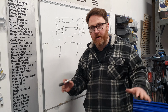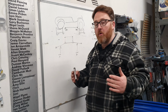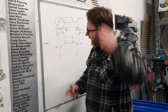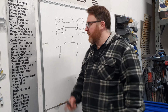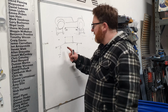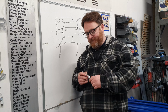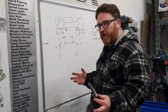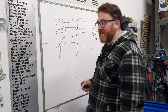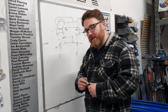All over, all correct. Now remember, these are all sat on the same chassis level, so they are going to need to be the same level in order for the ride height to be correct. Therefore, if they're all at 3 degrees, that's going to also be correct. Make sense? Now, what we need to establish is what this distance needs to be. And that's where it gets a bit tricky. On the fronts, that's a 45-degree angle, but on the backs, it is as near as damn it a 90-degree angle. So these are not going to be representative front to rear.